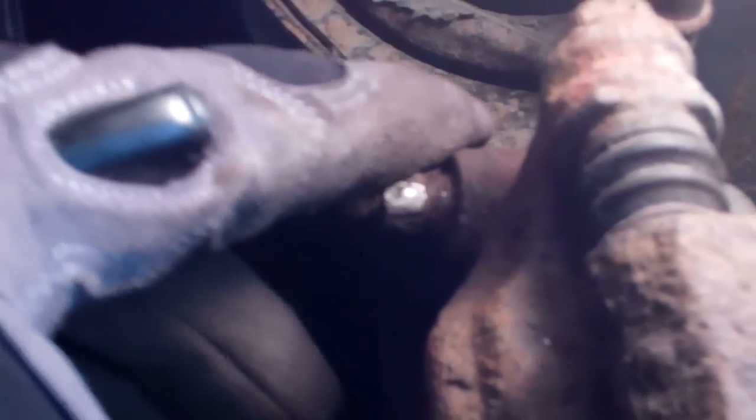I'm going to use a technique here to grind this off flat, to get it flat enough so that I can get a better grip with a set of vice grips, because it's basically rounded now.